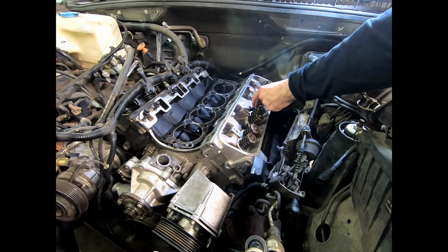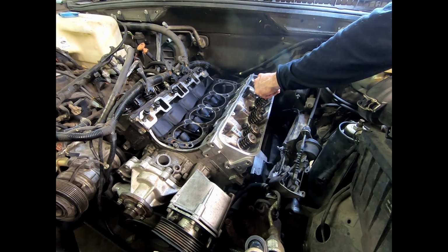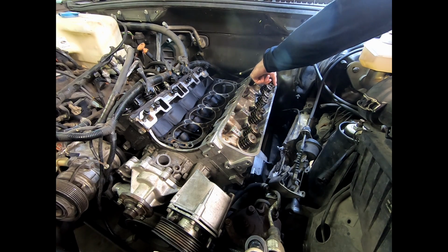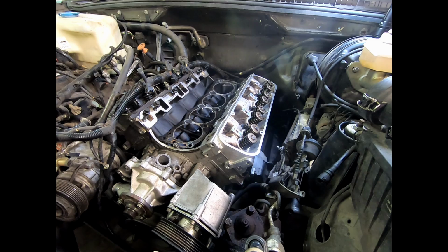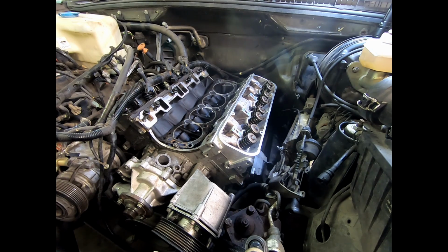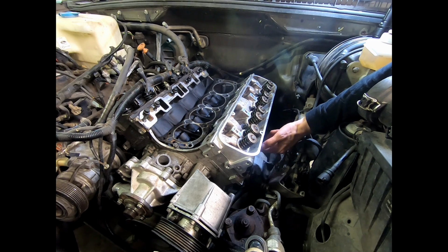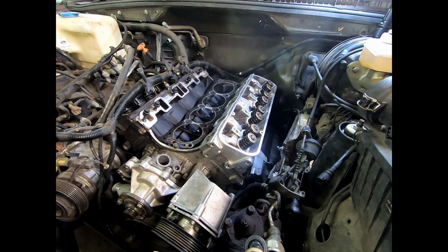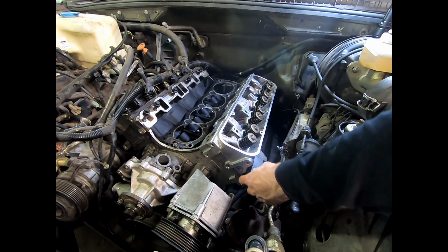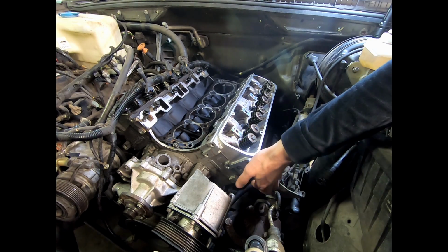So the reason they have you get both sides surgically clean is because one side, the clean side, clamps to the aluminum of the head. Make sure that's seated. The other side, as you torque it down, the nut will spin on top of the now lubricated washer. The dry side, in theory, in a perfect execution, will stick to the aluminum of the head. So that is where your superior clamping force comes from.